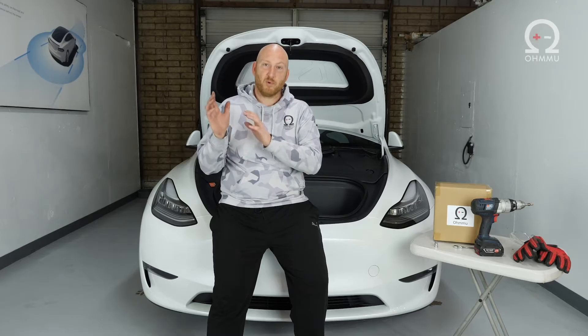In terms of safety, with an electric car like a Tesla, you've got a DC-to-DC converter which brings 12 volts live out of the big battery pack. This car has a 350-volt or 400-volt battery pack depending on which model you have, and that gets converted down to 12 volts. That means even if you don't have a 12-volt battery attached, there is the potential that the 12-volt system is still energized, which could lead to unexpected behavior, shorts, and sparking. So we want to remove the safety disconnect loop. Also wear gloves, because with the original lead acid battery, sometimes they spew acid.